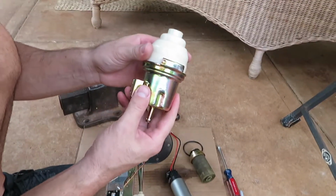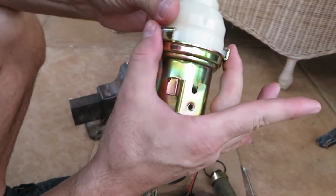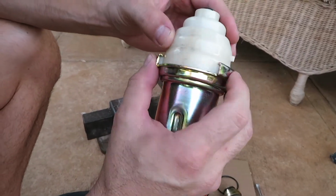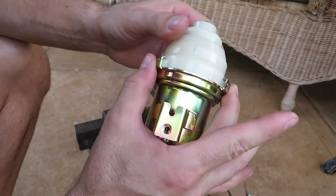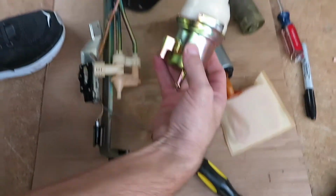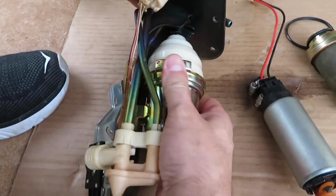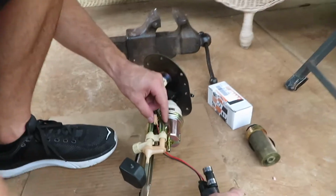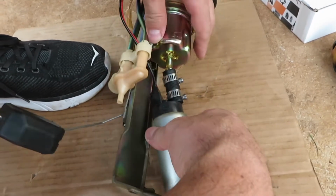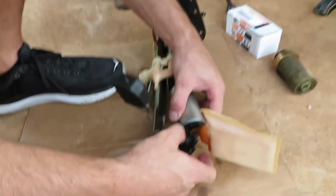So we got the micron filter installed. I did have to pry these up and then tap them back in so it clamps them. The channel they sit in is kind of tricky, and they're plastic, so they can be brittle. So the way I did it worked. So we're gonna reinstall. So this backside goes on the plate over here. We're gonna put that right on the nipple here. Just weave this through here, same route we had last time. And we're gonna put on the nipple first directly to the filter housing. Okay. And then this shoe here goes on the bottom.